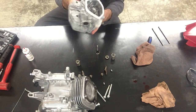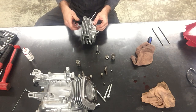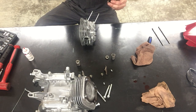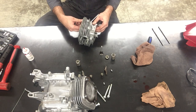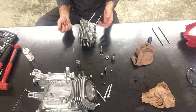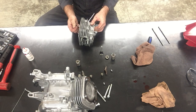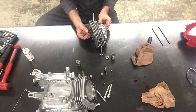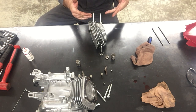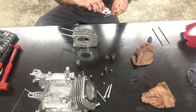It comes through the other side. To check how well a valve fits - think of this as a piston and the hole it goes into as a cylinder. If I plug my finger over the end when I pull it out, it should create a seal and suction. I felt the suction on my finger and then heard that pump noise as it came out. Vice versa, if I push it in, I should feel a little bit of pressure on my finger. So as I slide the valve in and out, I'm actually feeling suction and pressure on my finger, which means it's sealed really, really well.